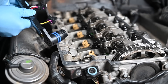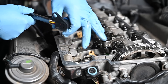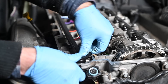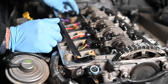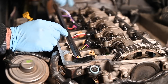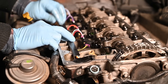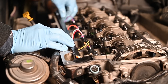So now we're going to put back the new wiring loom. I'm going to oil the seals here just a little bit - not a lot, just a little bit. Let's see if we can get that in there - make sure it's fully in. And now we just reconnect the injectors. You can't really miss because they're all keyed. Try to hold it in place a bit, but the cover will keep it in place so we don't need to worry too much about this.